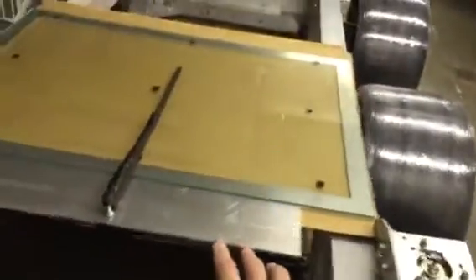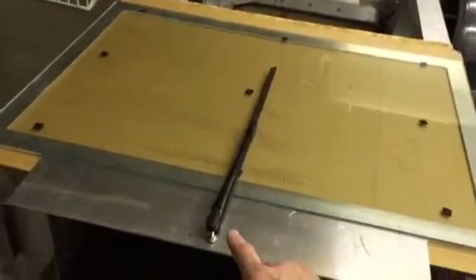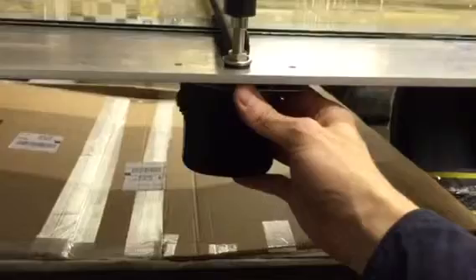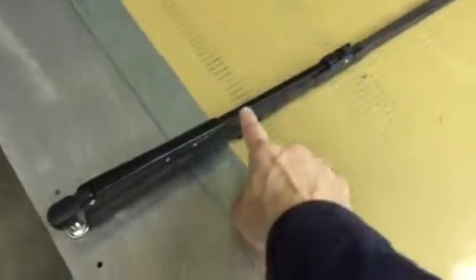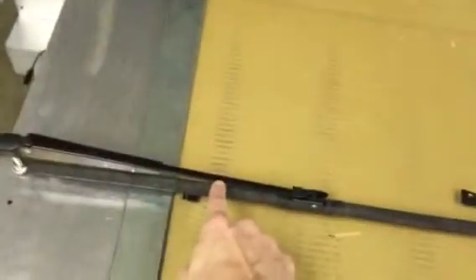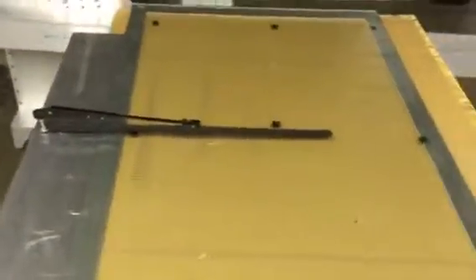Here's the windshield frame cut from Big Blue Saw. This is in the Wikispeed Dropbox for anyone who wants to play with it — it's open source. It uses an off-the-shelf windshield wiper motor assembly and a 28-inch wiper to clear the whole glass from the center. The problem is this windshield wiper arm is not as long as I'd like, even fully telescoped — I'd want it about another four or five inches. I think we can make an arm insert from a piece of aluminum with the right size hole cut, so we'll try fabbing up the extension.